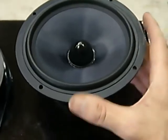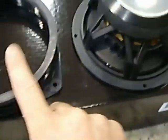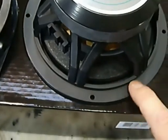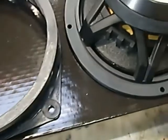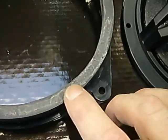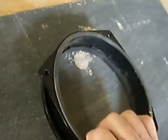The second reason is that our CX and X-Series drivers utilize a composite material basket, which means these two pieces of material are similar in their ability to bond. So all I have to do is take acetone and clean the perimeter of this off. This is a painted surface, so we're going to clean the perimeter so the composite material is exposed. Then I'll acetone wash both pieces. I have a sanding board and I just rub back and forth until the surface is roughened up.